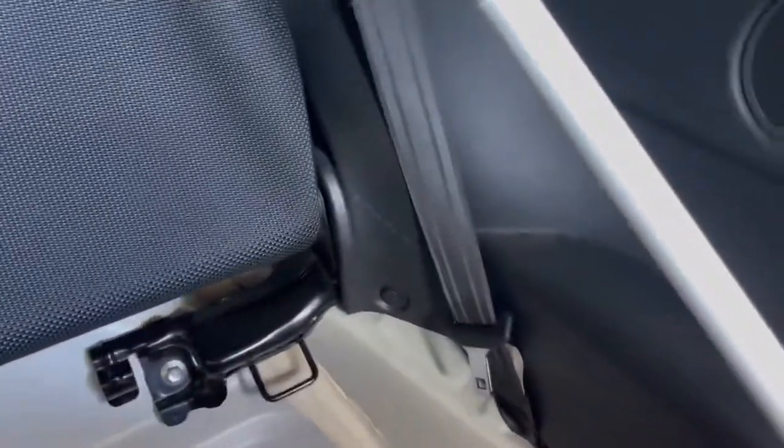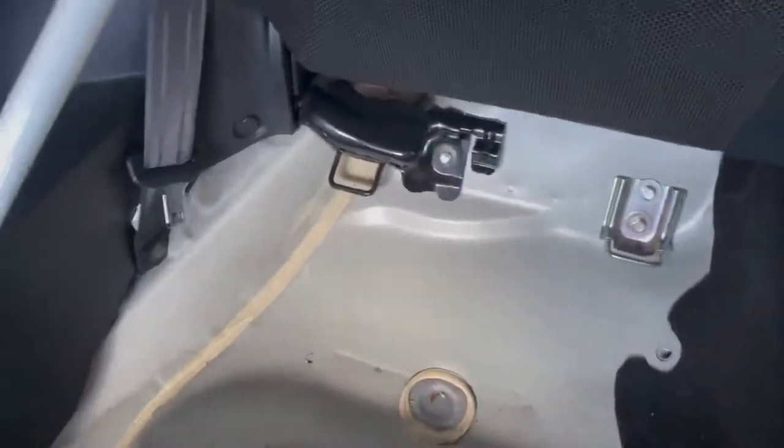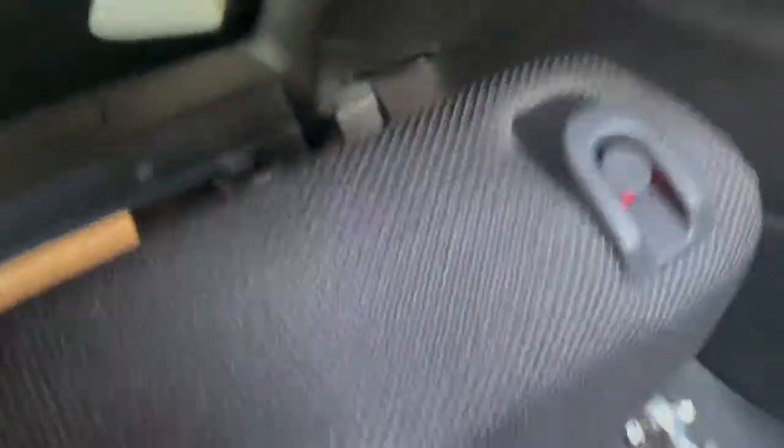Now that you've got this part basically loose, all you're going to have to do is take off this plastic cover right here, and that frees up the section we need. Same goes with the other side. I like to keep my tools on the passenger side when doing all this because it makes it easier and you don't have to keep getting in and out. We need to undo this clip and any others to take off the liner, and we'll also be removing the seat belts. Don't forget to undo the pins on the side as well — those three pins and then it pops right off.